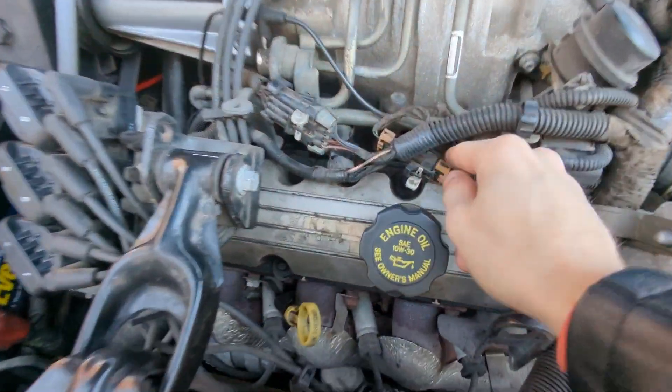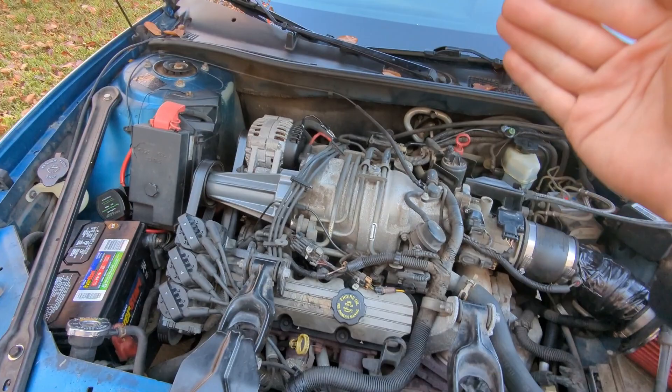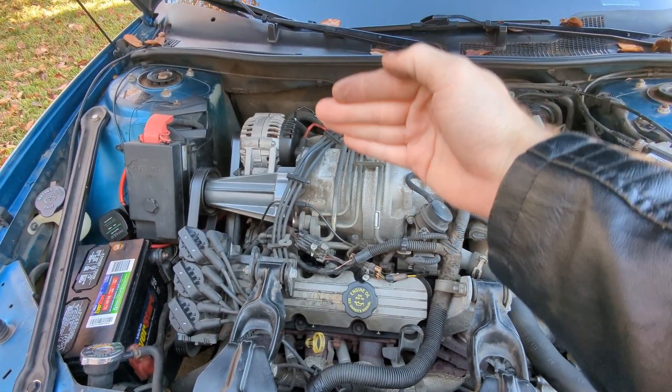When I was looking at one of my injectors, I can see — do you see all of that wet stuff down there? That is fuel. This fuel injector right here is leaking. So my fuel pressure is off, and whenever my engine isn't under load, it just dies.